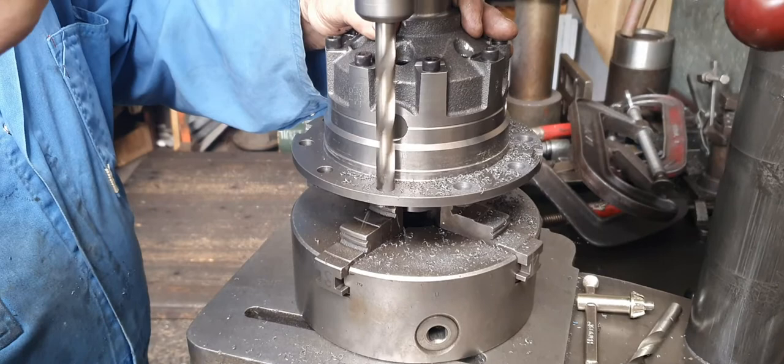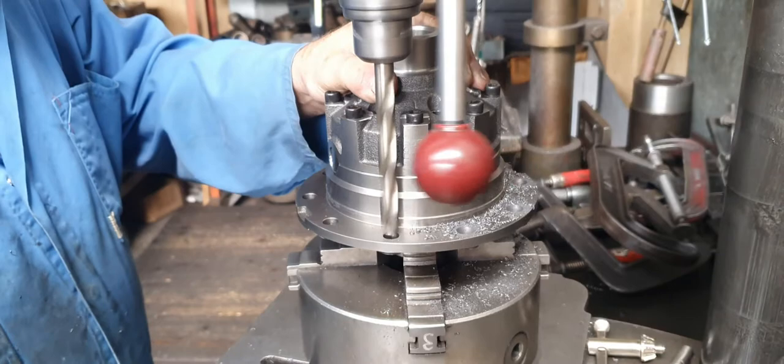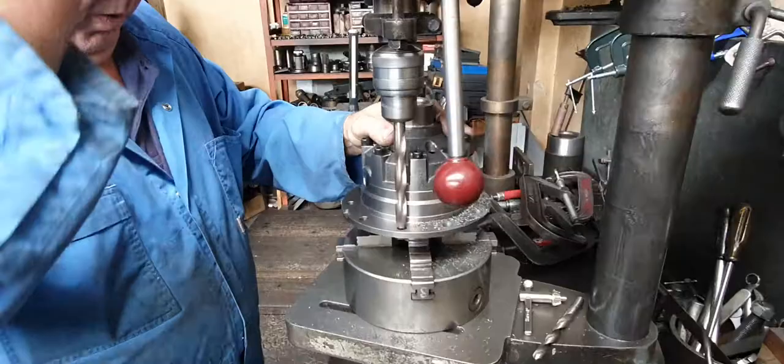The bolts that were in the packet that go into the crown wheel didn't fit. They didn't fit through the holes. These have been drilled for clearance from 7/16. Half inch bolts required, eh?